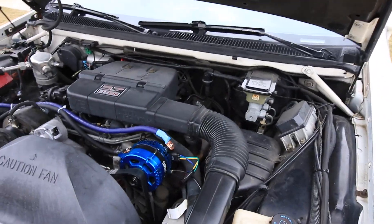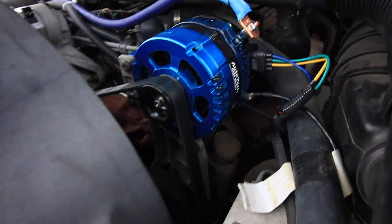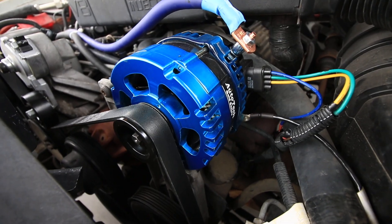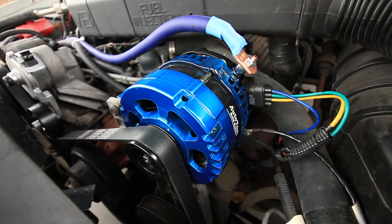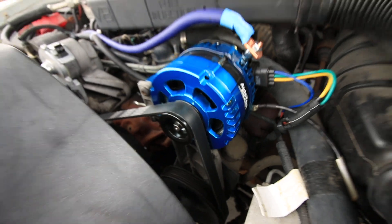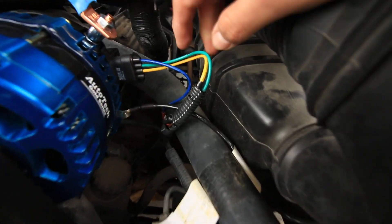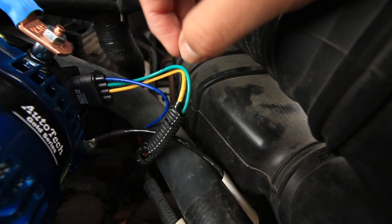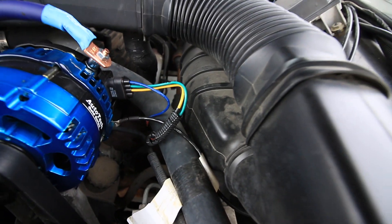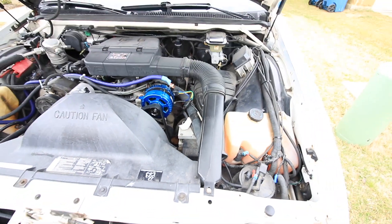The reason I did four is because with a powder-coated alternator, Auto Tech recommends that you ground it if you're not getting the right voltage. I just went ahead and did it anyways, and I am getting 15.2 volts. There goes my alternator right there — it's a real nice candy teal, or teal blue is what it's called. It's like a bluish green. It is putting up 15.2 volts and looks good so far, working good. They send you one of these wiring harnesses and you have to tap into your existing harness, but it's real easy — you just follow the letters. They've got videos online that can kind of help you. It's real easy, straight to the point.